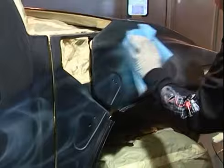And wipe it down, all the overspray, which will give me a pretty good accurate idea of what kind of pattern I'm laying down. Plus it'll control later on down the line, the more overspray that you have in the vehicle, the harder it is to wipe down. So you want to stay on top of that, especially with pearls. And I can come back in right after I wipe it down. Come back in, keep the flame going.